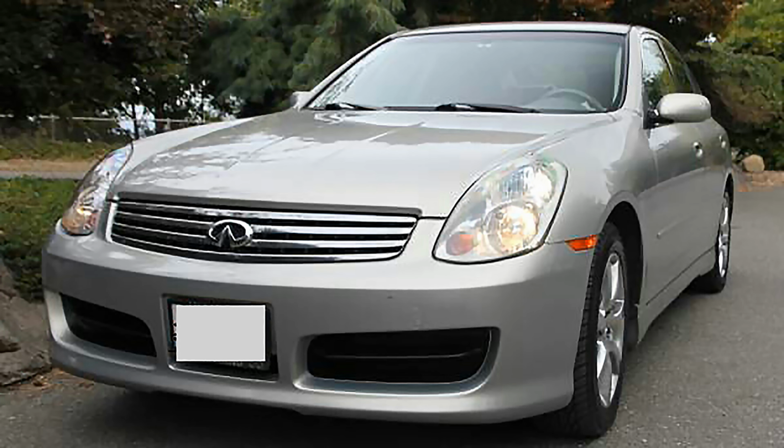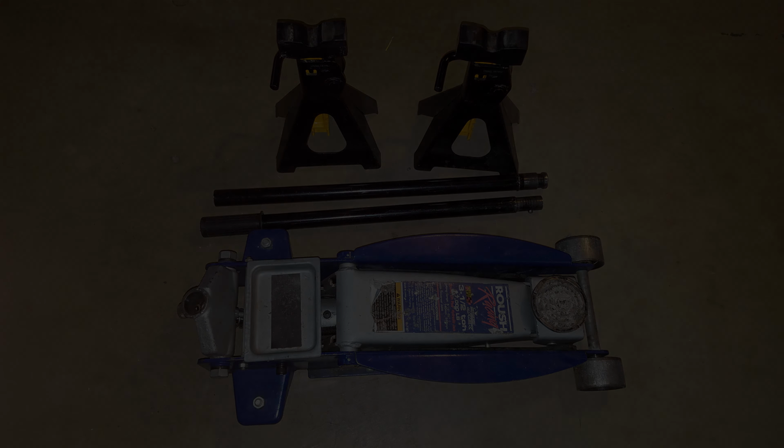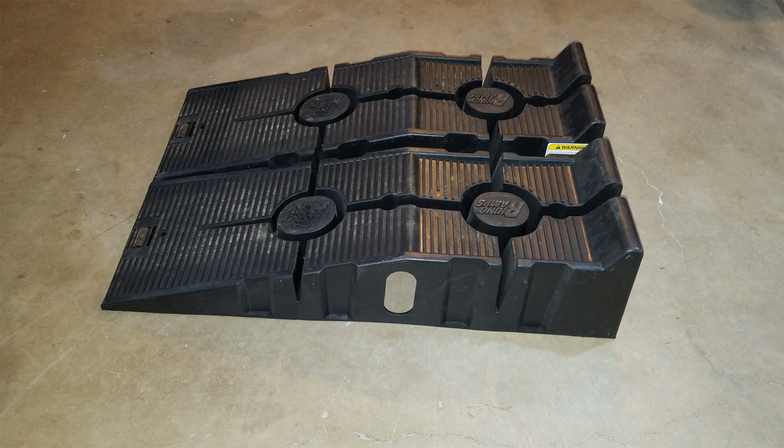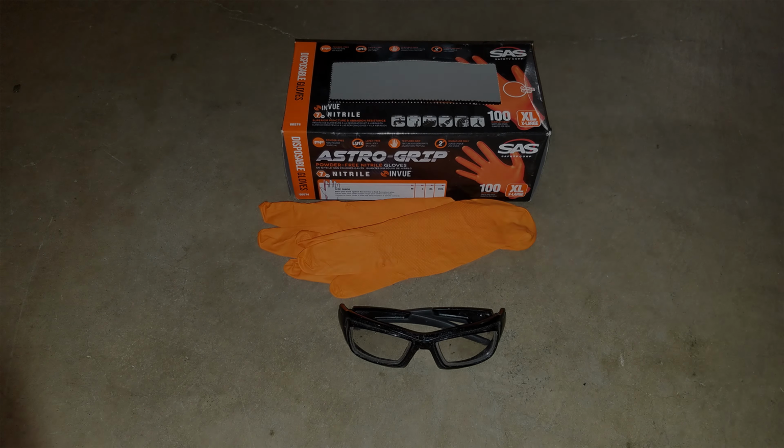Okay, so let's go over my setup for this oil change. I have the car backed into the garage here and I have the garage door closed. So I'm going to be using a jack and jack stands instead of using ramps like I normally would. I also have the back door open to have adequate ventilation, and I'm wearing some nitrile gloves, and I'm also wearing some glasses to protect my eyes. And I'll put a link in the description below or somewhere in this video to the video that I did on jacking up the front end of the G35.